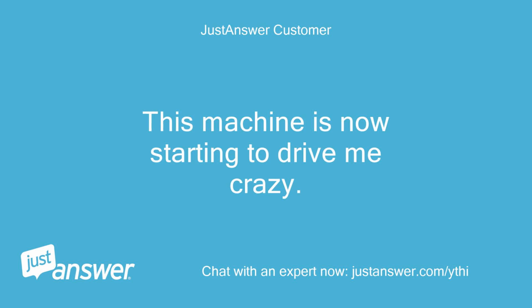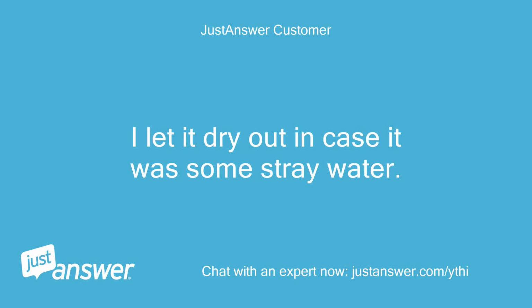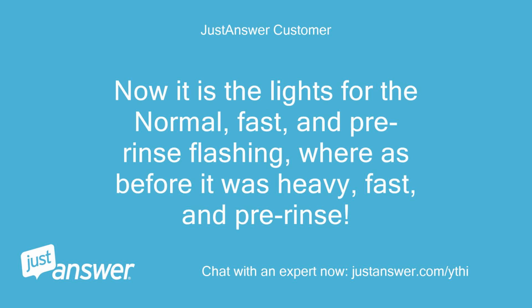This machine is now starting to drive me crazy. It appeared to start working, then started tripping the home safety switch. I let it dry out in case it was some stray water. I have checked out the flood switch more than once and it appears to be okay, but it is back to having the pump continually running, with the beeping and flashing lights, with one difference. Now it is the lights for the normal, fast, and pre-rinse flashing, whereas before it was heavy, fast, and pre-rinse.